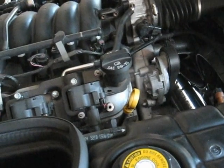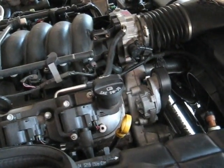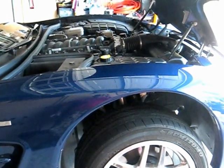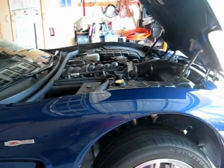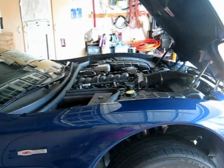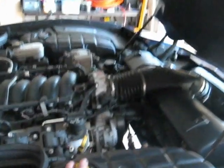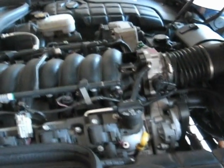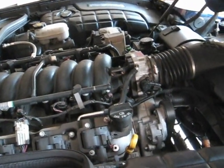Don't forget to put some coolant back in there. I'm going to fill it up with coolant and run the car. What you want to do to burp it — they call it burping the car — it's good to have it up on an angle. A lot of my coolant has stayed in the engine block because of the angle I put it on. You fill it up, you have to get it hot so the thermostat opens up and lets coolant circulate to the radiator, and then you're going to start pushing air into the engine block. Once it gets hot, keep this overflow tank full — it's pressurized. Be very careful, because if you open this up under pressure you could get a bath. You have to do this two or three times. Drive it a little bit, watch your temperature gauge, make sure you don't overheat it.